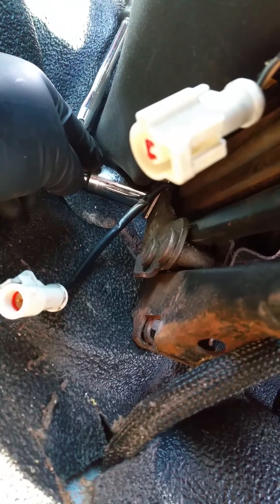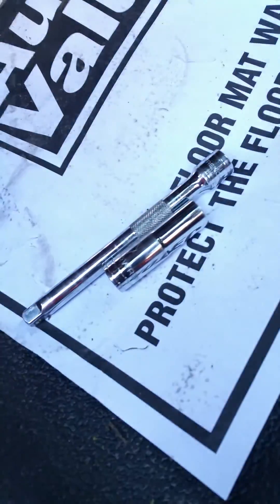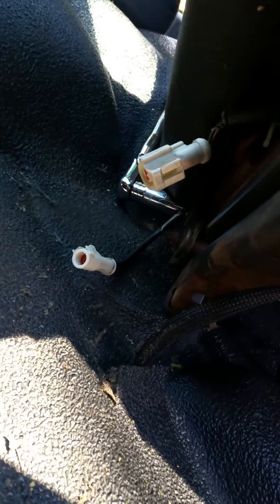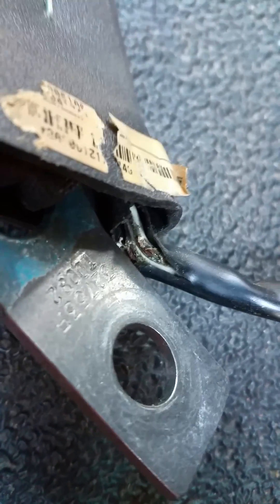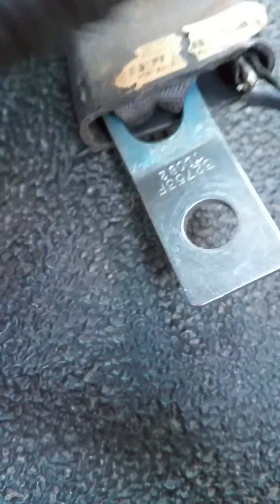Right back here I gotta pop it off. I've got a three-quarters on it using a three-eighths ratchet — good fit in there. After you take the seat out you've got multiple bolts, two bolts in the front, I believe they're half inch. I'll pop that out, take the seat belt out, go back there and test it. Came back — looks like that's my problem right there. I found a bent splice wire. Well, that might be my solution — might not have to replace the whole thing.